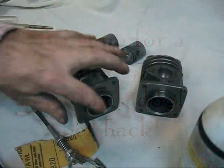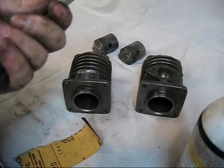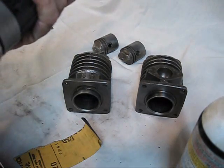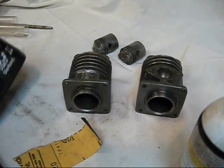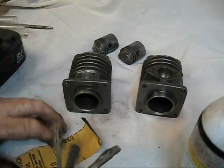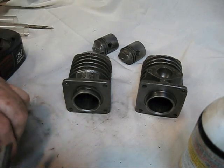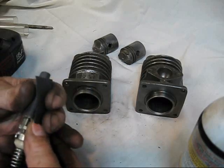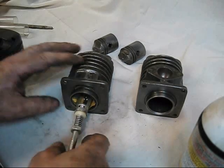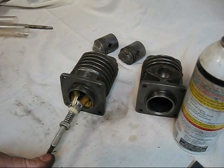I've got the little — this is a one and a half inch piston size in there — and I do have the battery powered drill out here today. I actually have about every tool known to man in this shop, and I can get above someone else's tooling real quick if I don't pay attention. So what I'm going to do: I don't want to use the stone on this cylinder, so I'm going to use that 320 paper wrapped around those stones, and I'm going to spray it down with PB Blaster. It seems to work pretty good — very gently.